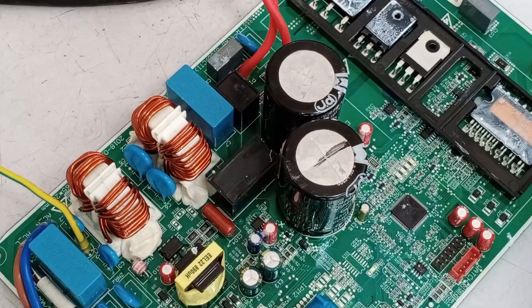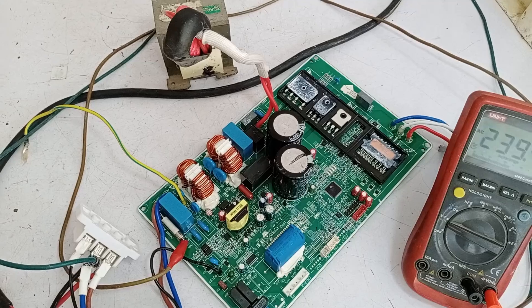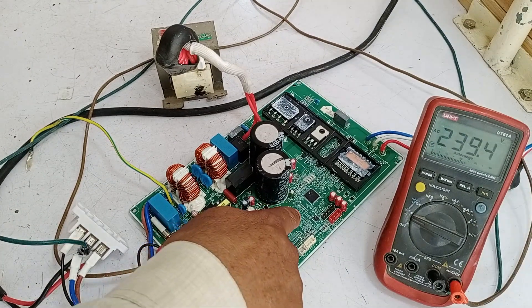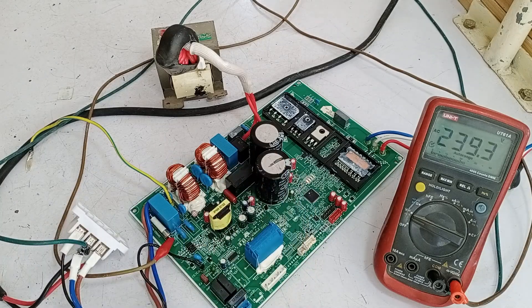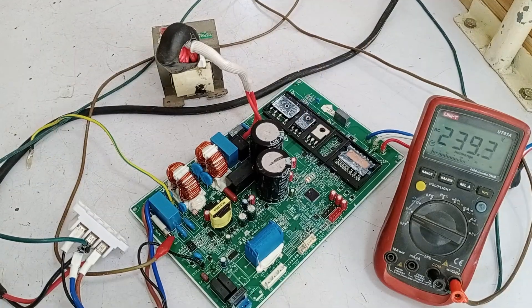When I was checking this circuit inside the unit, it suddenly shut down the compressor. Let's analyze what could have caused the compressor to shut down suddenly. The control board is powered on and LED number 5, which is green in color, is functioning correctly, indicating proper operation of this circuit board. The other indicator lights on the board are also on.